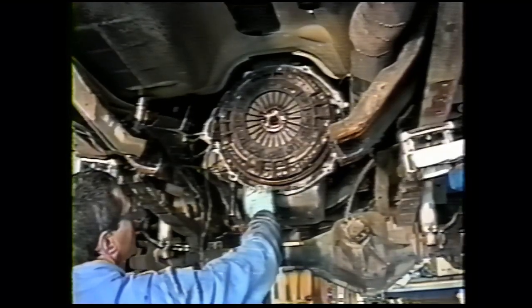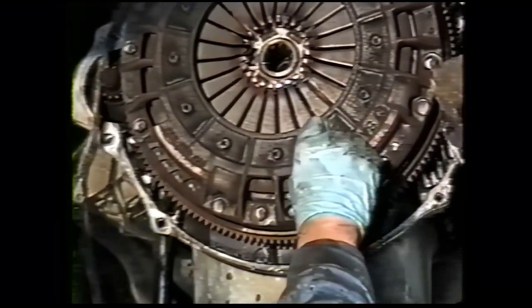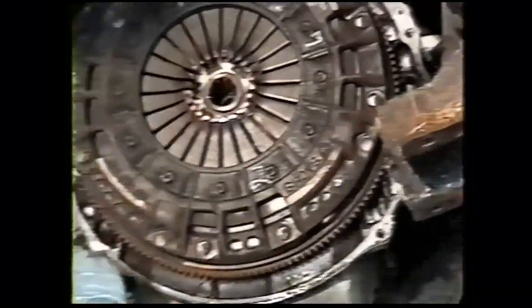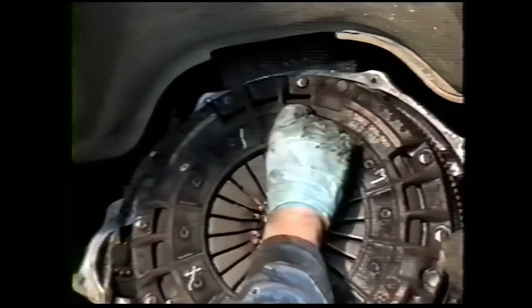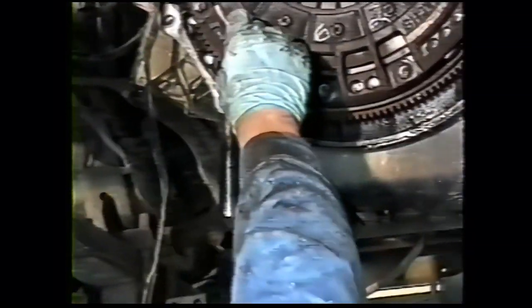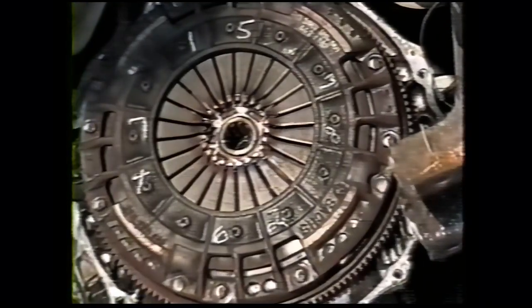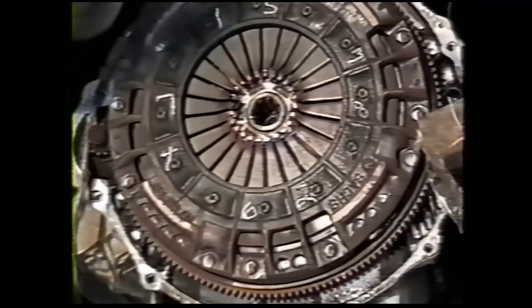The clutch cover has 5/16 bolts with 1/2 inch heads that hold it in place. Mark each bolt with a number in an alternate fashion, like you were going to be removing a wheel. And we're going to loosen each bolt 1/4 turn alternately at a time. This takes a little bit of time, but if you want to reuse the clutch, this is a critical part